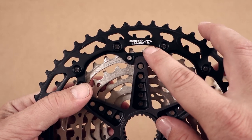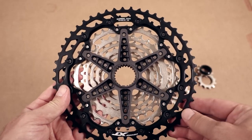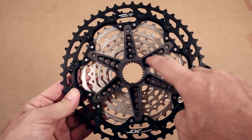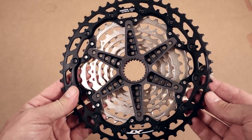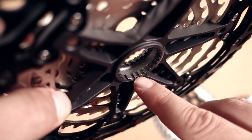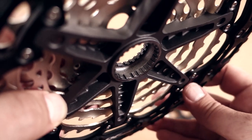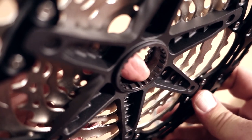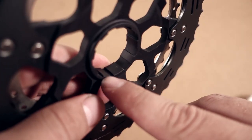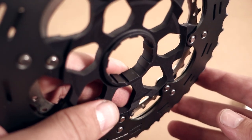CSM 8100 12-speed made in Japan. The only other thing that's new here is the spider design. This is called the beam spider, which is hollow in the middle and it makes room for all those rivets to hold the cogs together. Also the way it touches the spline is different — you can see you have touch points here at the beginning of the spider and at the end of it, with the machined out portion right in the middle. The old spiders were a solid piece of aluminum and you usually had two spiders in a cassette.